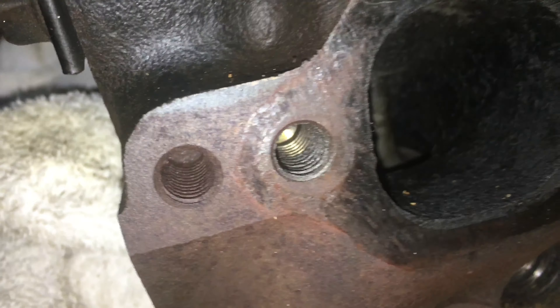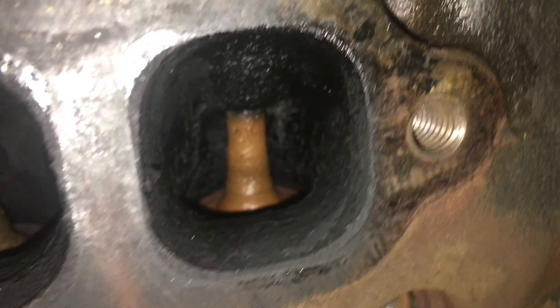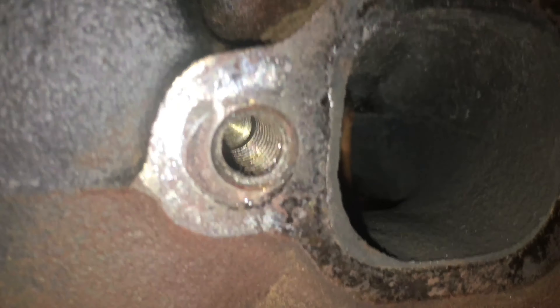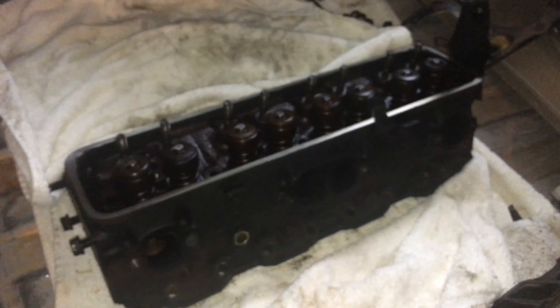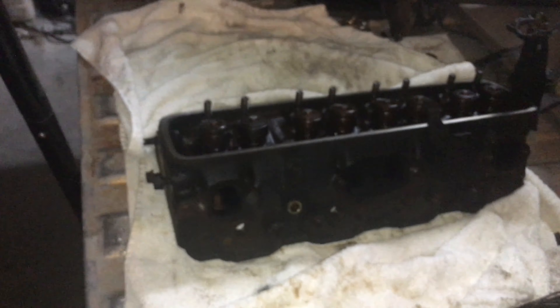That's pretty bad. There's some shavings in there. The head that got beat up the most by the piston — that was the only one that got chewed a little bit. But this one here had no damage from the piston, everything else was fine, and it's all tore up on the exhaust side. Fantastic — aluminum heads it is.